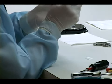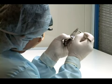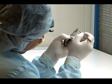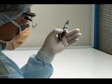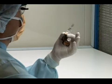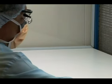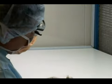Right now he's inspecting the heads to see if there's a crash on the hard drive. It's usually easier to tell whether there's a crash by actually looking for debris on the head surfaces themselves than it is on the platters, because on most of the platters you can't see the surface except for the very top side of the top platter.